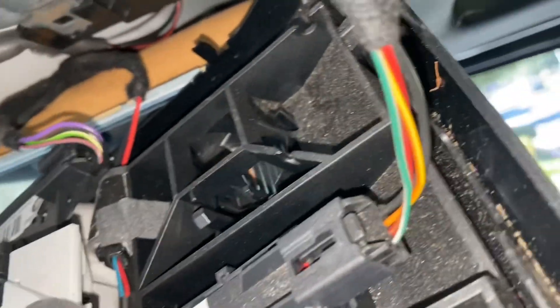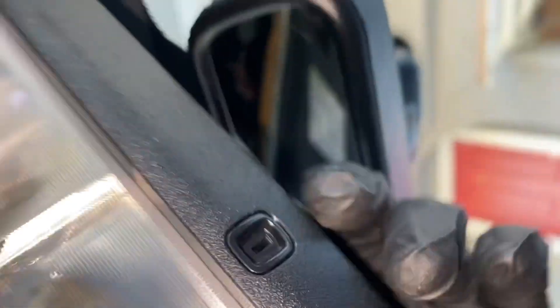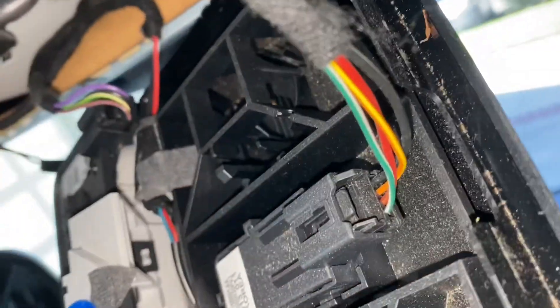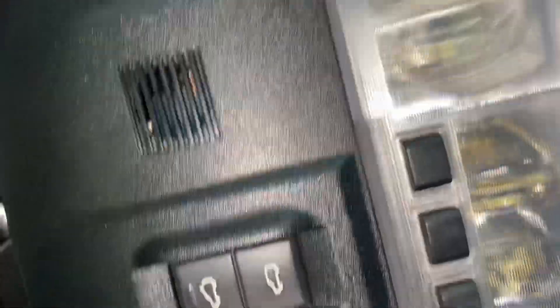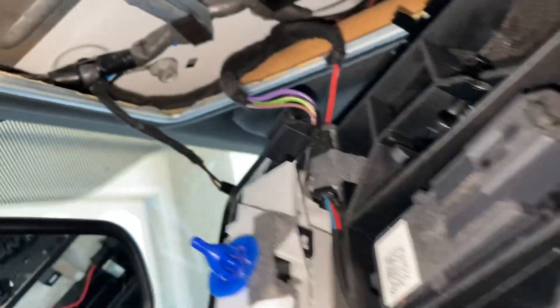This is related to the sunroof — I don't need that. This small one is a diode which gives the light in this area. There is another one which goes somewhere I'm not sure, and probably something goes to here — maybe it's the volume sensor part of the security system. And this one I believe is related to the lights. Let's find out — let's turn the light on and unplug this one. Yeah, you see the light is not lit anymore.